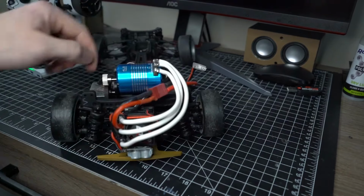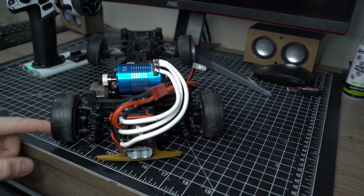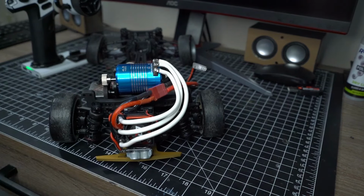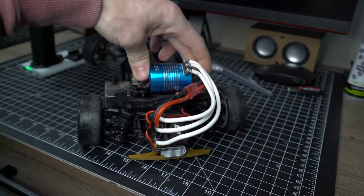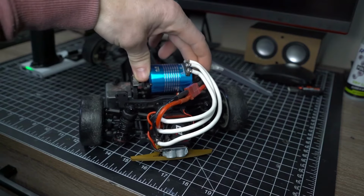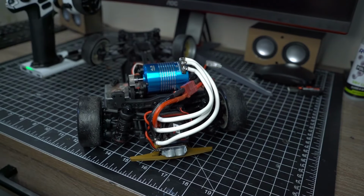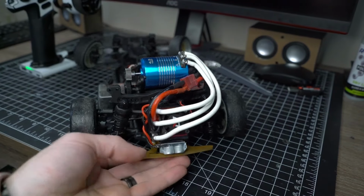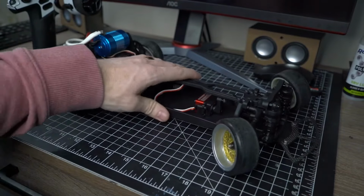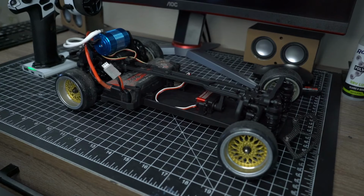The rear I checked. And then I set each wheel to like -3 degrees to start. There is a little progression when it leans, so we'll try that first. Gonna run it stock. So once that gyro gets in, we'll be able to go run it and see how it does.